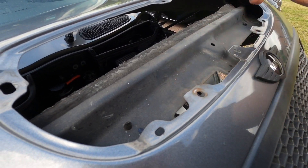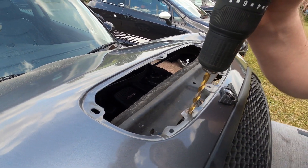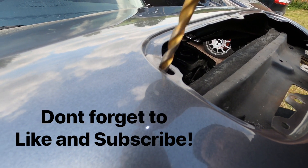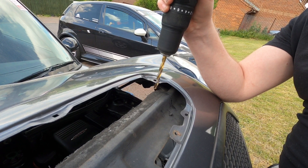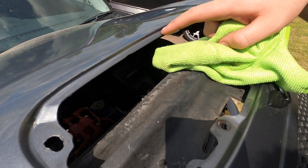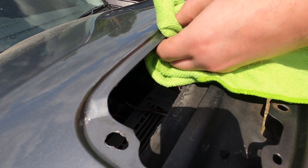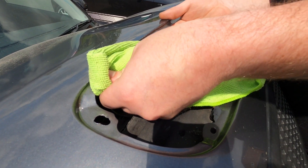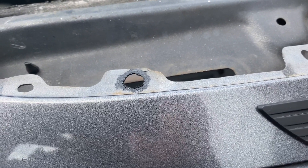We're going to drill out each of the four holes - they're about 7mm so we'll start with an 8mm drill and see if that fits any better. Once drilled, there's a metal rim that goes all the way around, and bending this down will make the scoop fit further into the gap so it looks more flush. Just be careful because the metal bits can be sharp. Go all the way around the edges and bend that little metal bit down. Once you've drilled the holes, it's really important to go over the drilled bits with some touch-up paint to stop them from rusting.